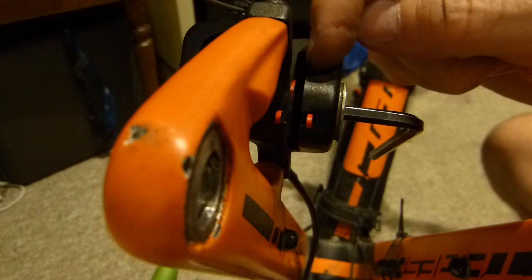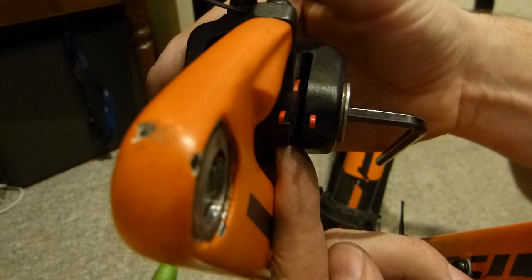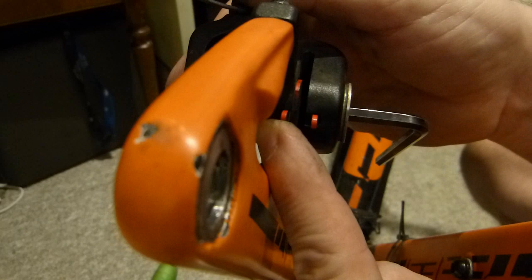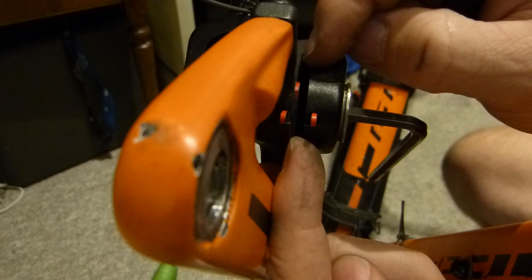So the brake pads have been installed, and working out the distance between them needs the wheel in place with the rotor rotating. And from here on, you need to make sure that the gap on the left side, we'll just go with left side because it's left side on the camera, on your TV screen as you are viewing it, okay? But if the bicycle was rotated upside down, it's still the left side. So this distance needs to be preloaded to some degree, so that it's just a tenth of a millimeter or so away from the rotating disc.